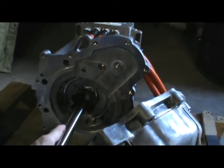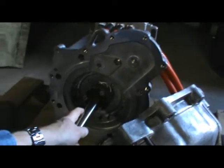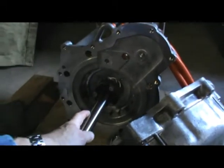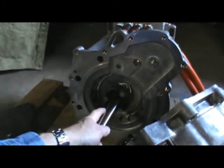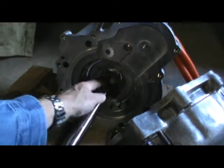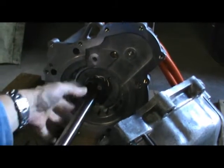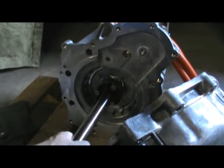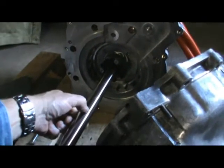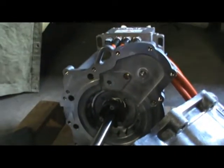We're not sure we even need a shaft on this end. We probably don't. So we're going to cut this down and fit it on the other side. And it'll go in about the same distance. But it fits so tight with no play that we'll slide the shaft in the other side and then weld around it. Because we need to extend out the back about 3 to 4 inches in order to attach a pulley and so on there. We haven't decided yet whether we're going to cut a keyway in this or whether we're going to get another clamp similar to this to hold our things together.